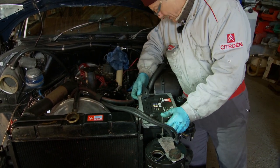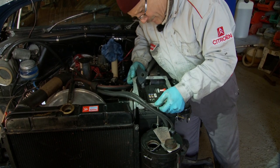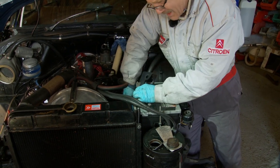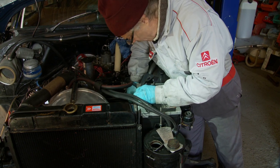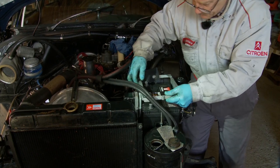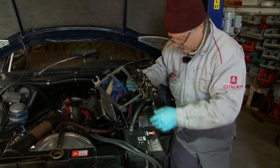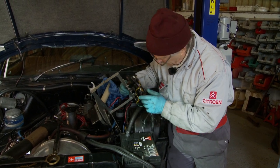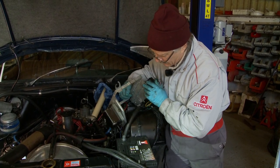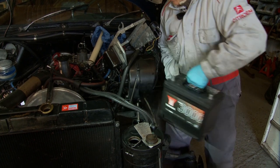With both clamp bolts off, the battery holding tray slides off the top. There's a hook on this side holding a couple of wires and the speedo cable, which I've just unhooked, allowing me to lift the whole tray up and fold it out of the way to give clear access to the battery. Battery is now free and you can just lift it out. At the bottom of the battery there's a plastic tray to catch any drips, and then the steel frame underneath.